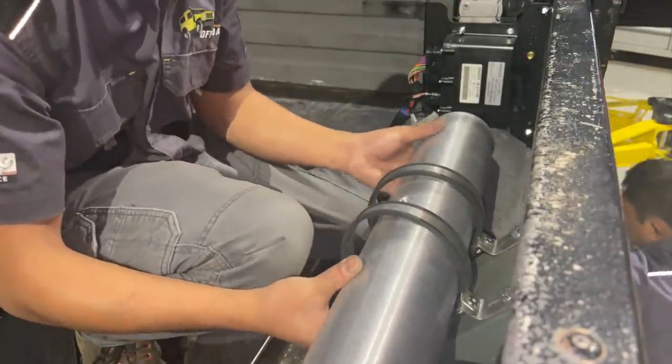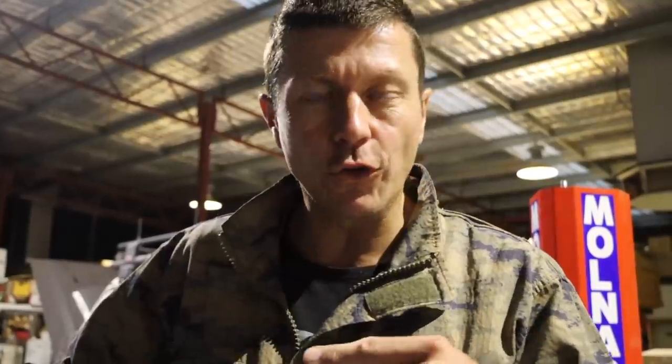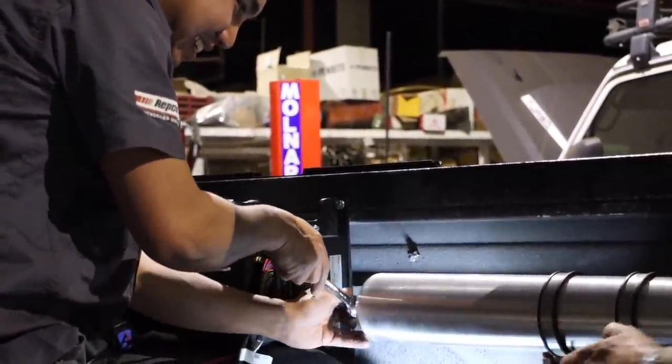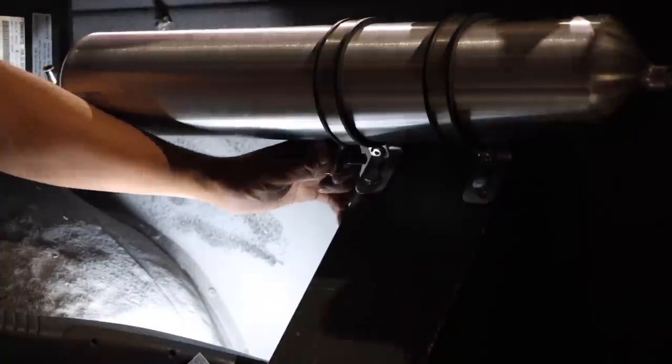Johar is explaining to me, as we're installing the four-litre compressed air tank, that there's only one inlet and outlet — it works like an accumulator. The compressor pumps up and fills the compressed air tank, and then the computer uses that compressed air in and out. It's also got a pressure relief valve on it. Very, very clever.